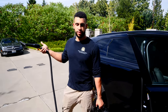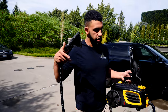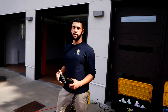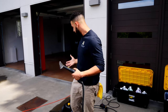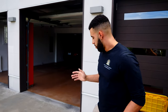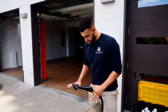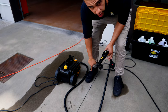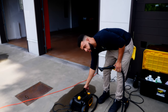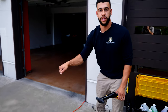Now, once you're done with your steam cleaning, you're going to want to put the steamer in an area away from everything else. The one thing you'll want to do is empty out all of the water. If you don't empty out the water, it's going to build up moss and mold on the inside of the steam cleaner, and then you're not going to be able to use it in the future. Since it's really hot right now, let it cool down — flip the switch from on to off so that it starts cooling down. Once this needle is no longer in the green area, you know it's safe to open up the lid and begin dumping the water out.